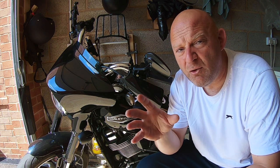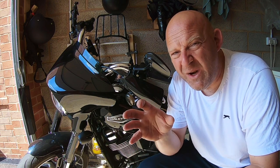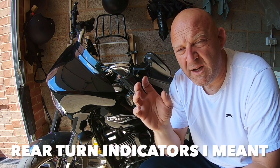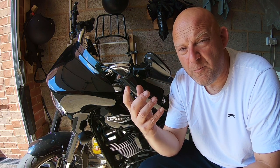I got an interesting email from Rob from Alberta in Canada. He was having a few issues with his rear taillights — basically when he was putting on the turn indicator, left or right, and then applying the brake, the rear taillights went out. There was also a high flashing rate on the rear taillights. He had also done an LED install on the front indicators, and what seems to have happened is that the re-synchronisation of the BCM didn't quite work properly. He had to redo it, which stopped the high flashing rate.